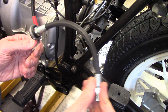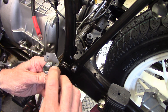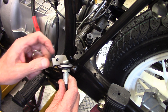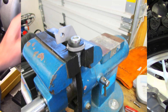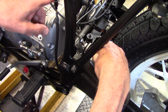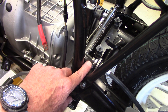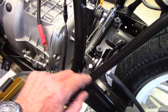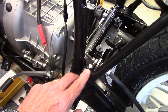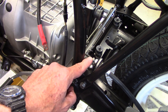This is the flexible rubber hose that goes to the rear brake caliper, and inside the bracket is a grommet. It's very hard to get the hose to go in the grommet, so it was easier to install that on the workbench first. I found it easier to thread in the nipple on the steel line into the rubber brake hose if you leave the bolt a little bit loose on the bracket, because then you can rock and move it to get everything to line up. Then I finger-tightened it all the way in and tightened both with a wrench.